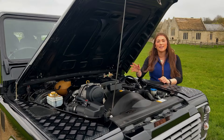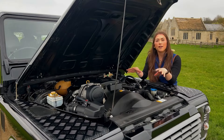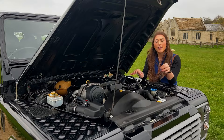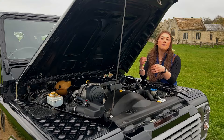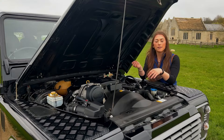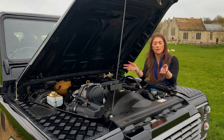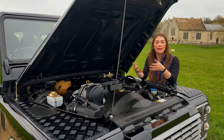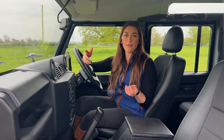The first thing you want to look at is the engine. Take a look inside the bonnet and check for any cracked or perished hoses, any water leaks that could be coming from the radiator, and also look for any oil leaks. There may be some residue but that's quite normal — if it starts to puddle then there may be an issue. Also check that there's no oil leaks on the gearbox or the transmission; some residue is fine but if it's dripping there's a problem.